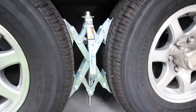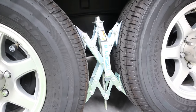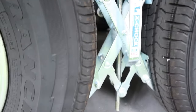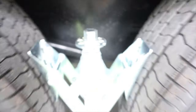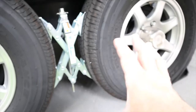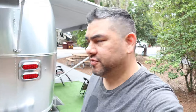X-chocks. Some people use these as the chock — I use both the regular wheel chock and then the X-chock. What the X-chock does is it actually locks both wheels in place so that wheel is pushing against that wheel. It comes with a wrench you can put here and spin it. You can even put a little padlock in one of the holes to secure it better. What this does is it prevents rocking — even with chocks on there's some micro rocking from suspension, but the X-chocks lock the wheels in place and keep everything stable.